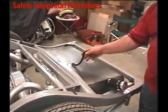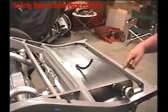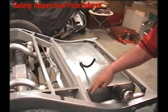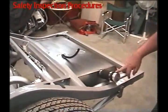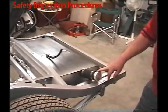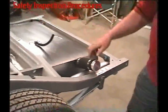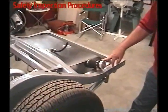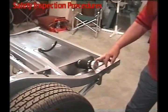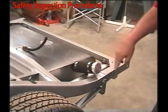This is the ventilation hose for the gas tank. It can run over the side of the tank and be mounted to your frame, or some guys will run it up into the fill tube with a vented cap, with a tube coming out of the top like new cars do and running it back into the tank. The cap currently on here is just a plug to keep the dirt off until the car is done.